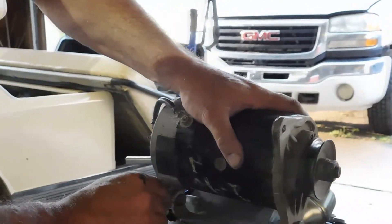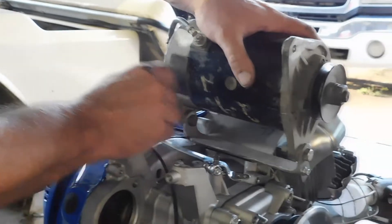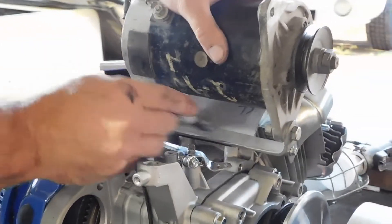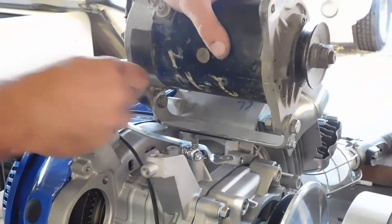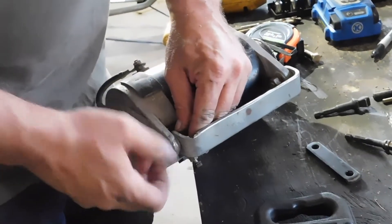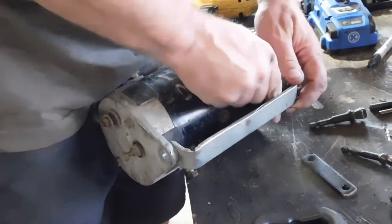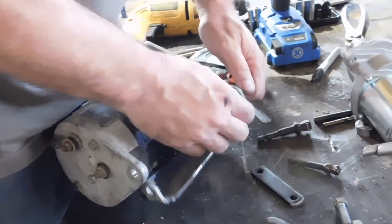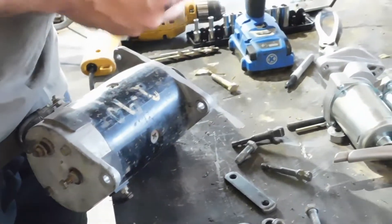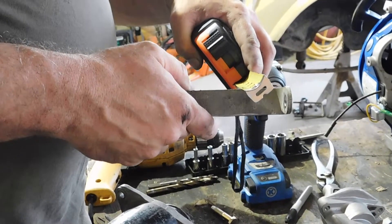Now I'm going to put a mark here and a mark here. That plate underneath there could have moved, so I need to know where to put the holes. I'll put another good mark there — more precision guesswork. The holes have to be fairly close; if they're not, I can just make the holes bigger. I've also got to get longer bolts because the original bolts that were in there are going to be too short.